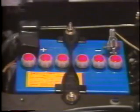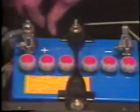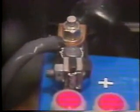We'll begin the starter system inspection now. Let's start the on-vehicle inspection with the starter motor mounted to the engine. First, check whether the battery is operating normally. Check for faulty battery terminal contact and for disconnection of the battery cable core wire.